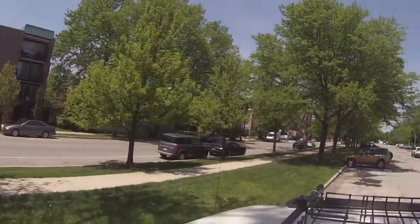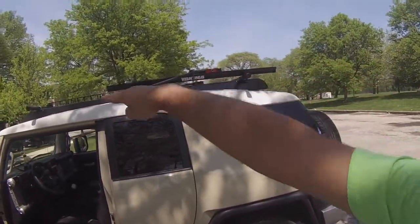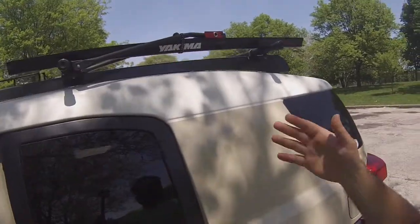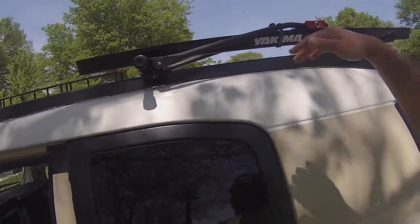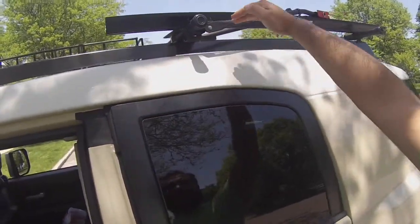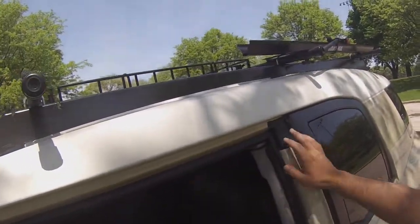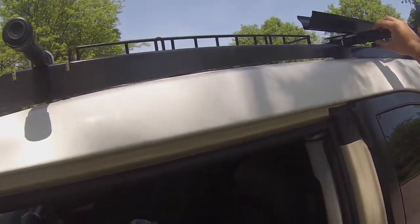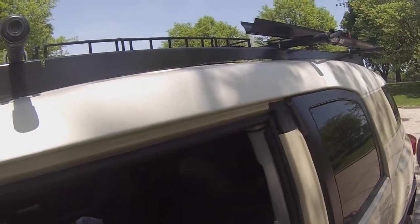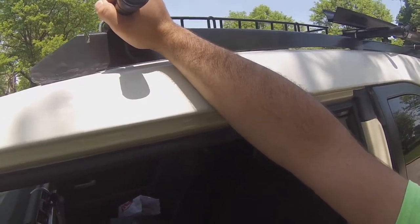The nice thing about using the AARV mounting kit and not some other mounting kit is that it's flat on top, which is one of the big things I wanted when I was looking for a rack. The reason I wanted it flat is because I like to put wood and plywood on top of my FJ at times, and since it's flat I can do that and mount it pretty nicely. Also, using 58-inch bars leaves me a little bit more bar on the side, so if I do put some 4x8 foot plywood on here I still have somewhere to grab my ratcheting straps to tie it down.